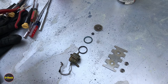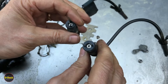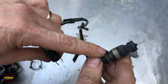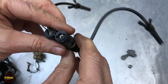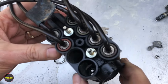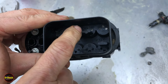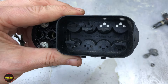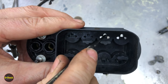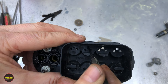Here's what the fuel injectors look like when they come out — I took a couple out to show you. You've got the injector body with an O-ring at the top and one at the bottom, and then the terminals. They can be pretty wedged in here after this many years. If we look inside with two removed, you can see there's a place to put a small punch or small screwdriver in the hole that's behind the two connectors.